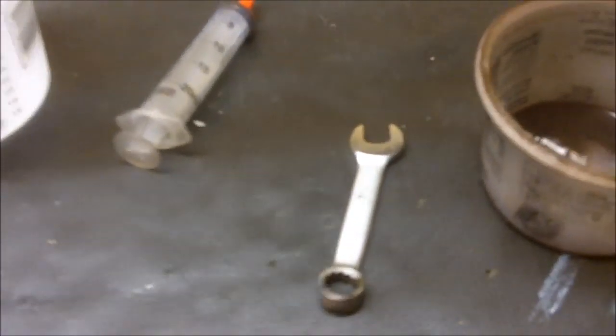That's a 13 millimeter wrench. We've got a couple of different bolts and things we're working with. Up here we've got the filler hole, this is the leveling hole, and here's the drain down here. I'm going to use the 13 millimeter wrench to unscrew the drain bolt and drain the old fluid into the bowl. We're not going to use the leveling hole because we're overfilling to 700 milliliters — normally you'd fill it with that unscrewed and it would just drip and level off, but we're going to overfill it. So we'll leave that in, have everything measured beforehand, and fill it through the filler hole.